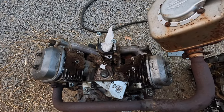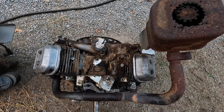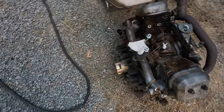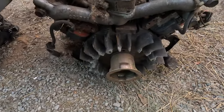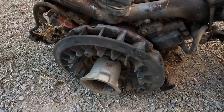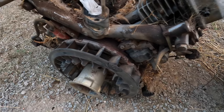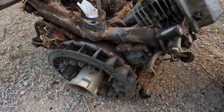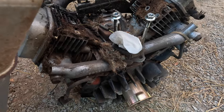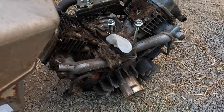You can see the 16 has a rat's nest in it and the 18 also has a rat's nest in it. There are really subtle differences on these — one being the flywheel, where the 16 has the cast iron flywheel and the 18 has just like a plastic shroud on it. I'm taking these apart because the 16 needs head gaskets. It's like every Vanguard I have leaks oil at the head gaskets — I don't know if that's a flaw or if maybe the head bolts stretch. I'm going to be ordering new head bolts and get head gaskets for the 16.